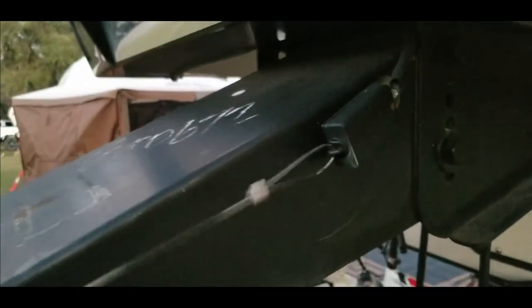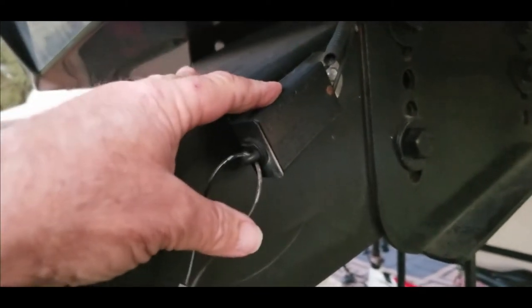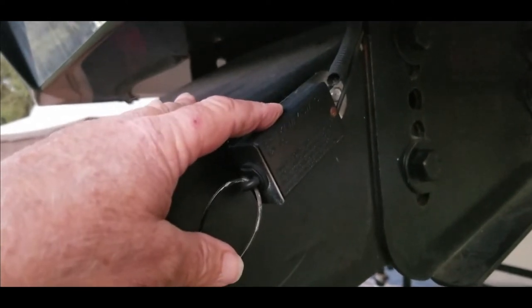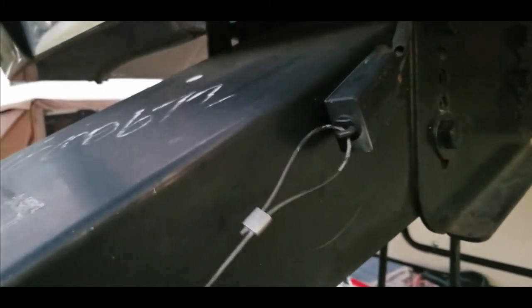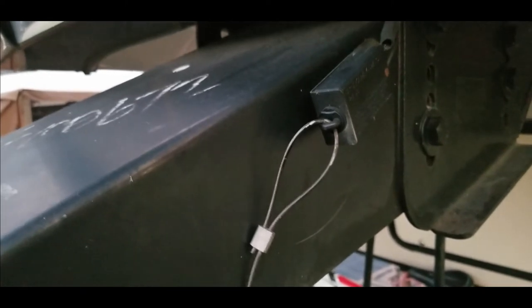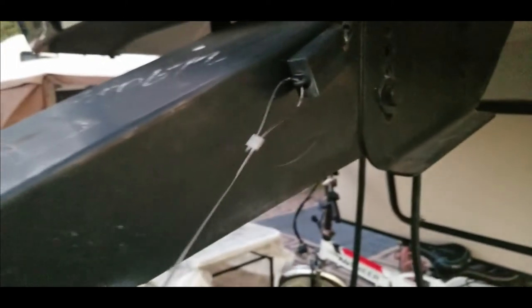This is keyed, only goes in a certain way — there it goes, back in it goes. This switch is in series with your electric brakes and the 12-volt house batteries. So even if the trailer disconnects from the truck and the power cord pulls out, the batteries that are on board will operate the brakes and they will lock up, because it will apply full power to them.